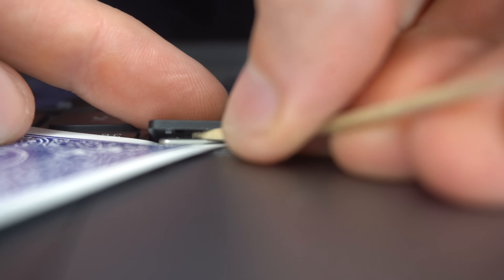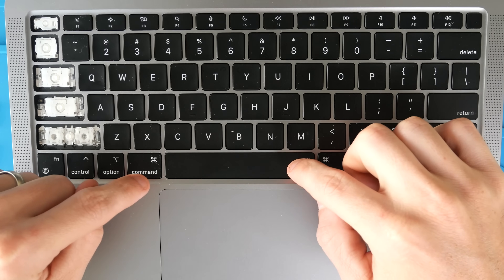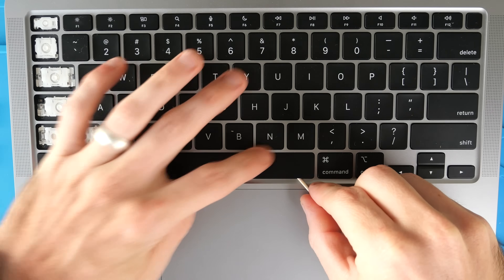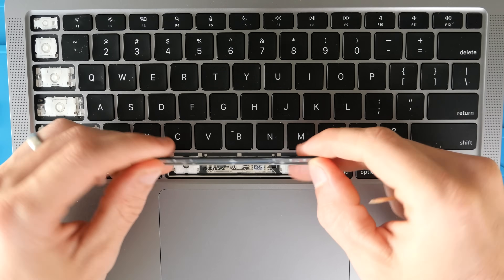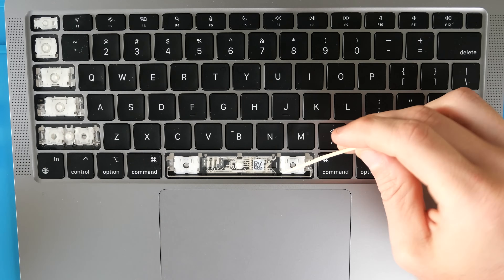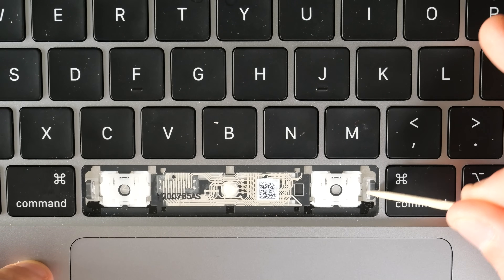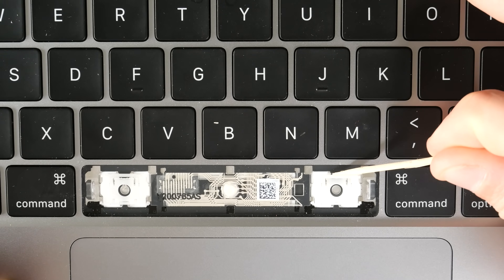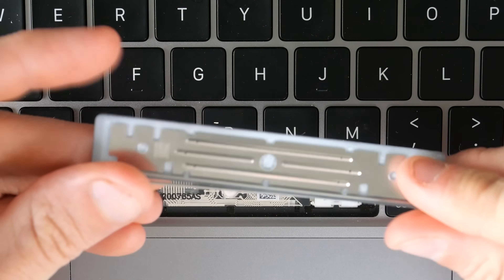Once you can see, get the toothpick on the corner between the key cap and the support bar, then run it along — you'll hear it unclipping. Remove that bottom support bar, then look for where the key attaches to the two key switches — one here and one over here. Disconnect the key cap from each key switch, move in that direction to get it off, then pull the key cap towards you and lift it up. The top support bar stays on the key; the bottom was detached and can just be lifted out. Be careful of the aluminum channel where the support bars rest — don't bend or break those, otherwise the key won't reinstall.